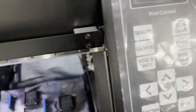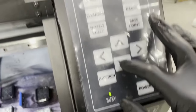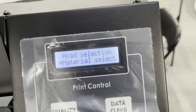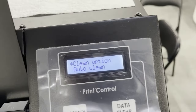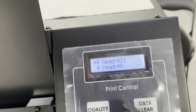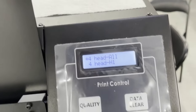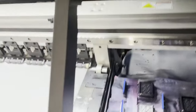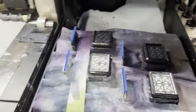Go to your control panel on the printer and hit Function. In the setup menu, go down to Head Maintenance and hit Enter, then go down to Fill Ink and hit Enter. For a four-head printer select all four — or two if you have two heads — then hit Enter. Your printer head won't move now; it's going to start sucking.